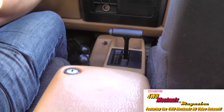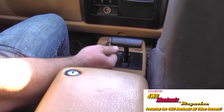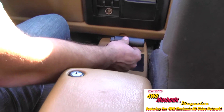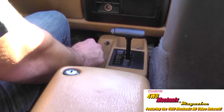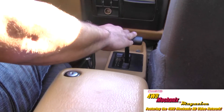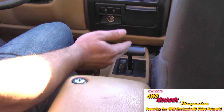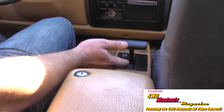Then we restart the engine and go back up to speed to approximately five miles per hour when shifting from high range to low range. Automatic transmission to neutral, the shifter comes out, and right before the vehicle comes to a stop you will notice it easily goes into gear. This will fix most people's concerns with shifting from high to low range by following those simple procedures.